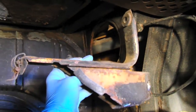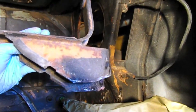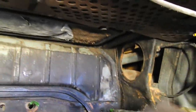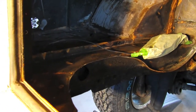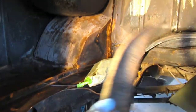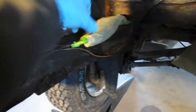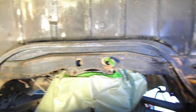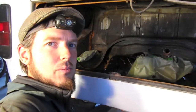The other thing I did was grind off this bracket which holds the air cleaner box - it sat approximately right there. The item that most people are probably going to be upset with is the cooling tin fin here - I actually ground that off. It makes it so much easier to mount a radiator. I did leave it in my '73 conversion, but this is just going to be a lot cleaner. I've also taped up some of the wiring in preparation for the rubberized undercoating.